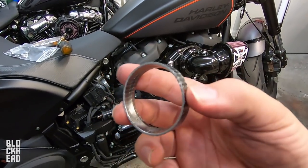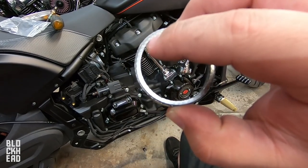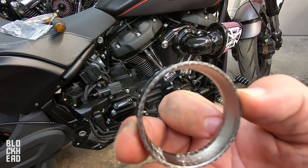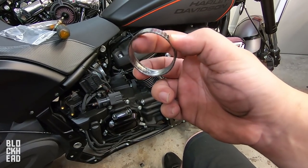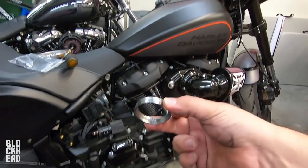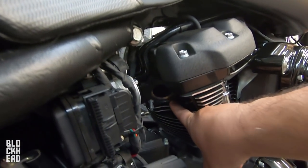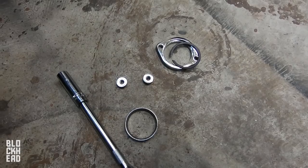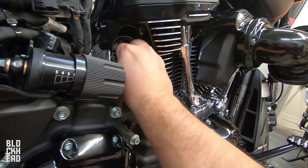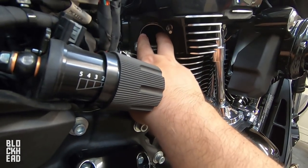Check it out — these gaskets are tapered. One side is thinner and one side is thicker. You want to put it so the thin tapered side is facing out and the thick side is against the engine. These are a pain to get on, so I'm going to show you a trick to get them nicely centered in that hole. Take the gasket with the skinny tapered side outwards and just barely put it into the opening — just enough so it stays on its own.